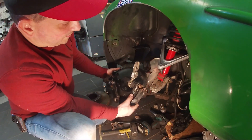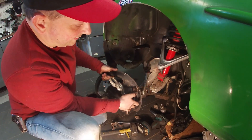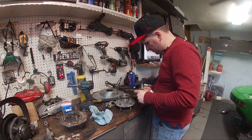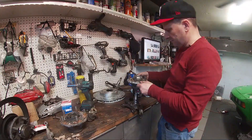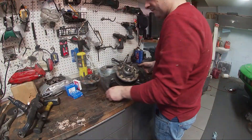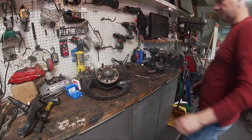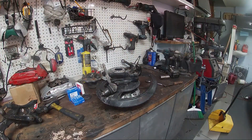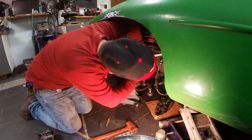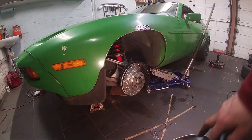I got the spindle removed with the ball joint attached and brought it over to the bench to get the ball joint separated. Now it's time to set up the 944 hub on the 928's modified spindle — new races, new bearings, and lots of grease. Next up is the backing plate, then the hub gets installed with the correct pretension on the spindle nut. Finally, the knuckle is flipped over so the steering arm can be attached using red thread locker on the bolts, and then the knuckle assembly is installed on the car and the rotor gets a good cleaning.